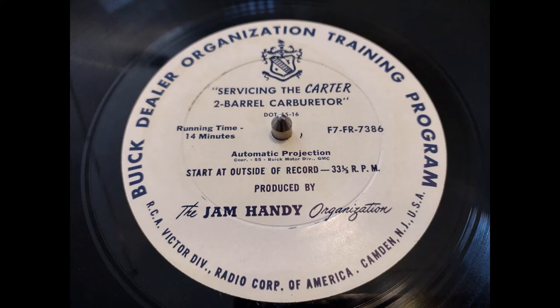The new throttle body is made shorter to reduce overall carburetor height. It is heated to help prevent engine stalling due to carburetor icing. Exhaust gas is conducted through a heat passage which is formed in the underside of the throttle body casting and the top of the manifold. The exhaust gas comes through drilled holes from the exhaust gas crossover passage in the intake manifold. Notice that the mounting flange gasket for the Carter carburetor has two exhaust gas holes while the Stromberg mounting flange gasket has none.